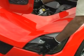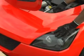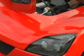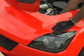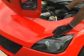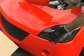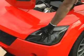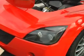Right. So now, after you've done that, make a visual inspection by sticking your head down here to see that your bracket is actually straight, hasn't moved to the left or to the right. If it has, slightly slacken it off and tighten it up with your hand. Then simply put the ratchet back in there and just give it a little nick. You don't want to tighten it too much, otherwise you might break something, but you definitely want it secure, hence a nylock nut. Okay.